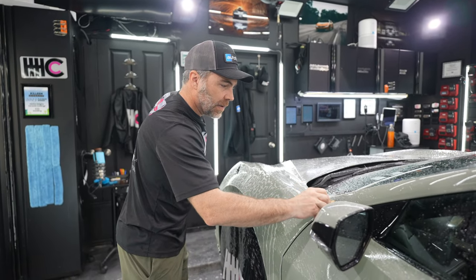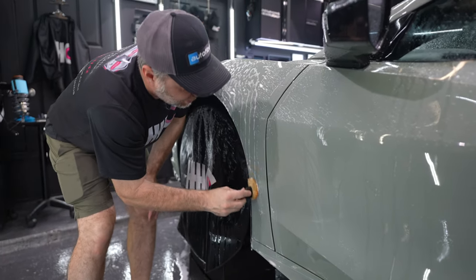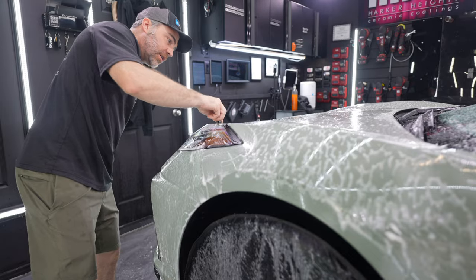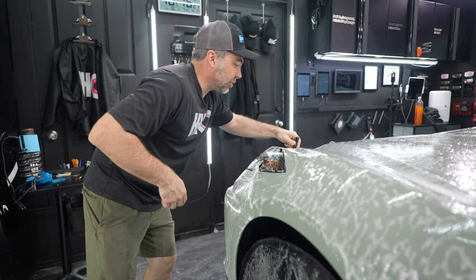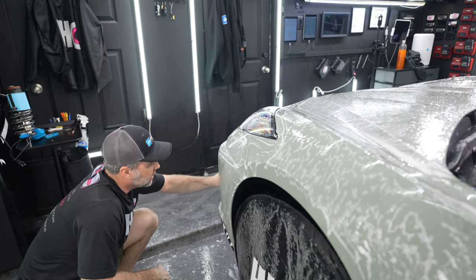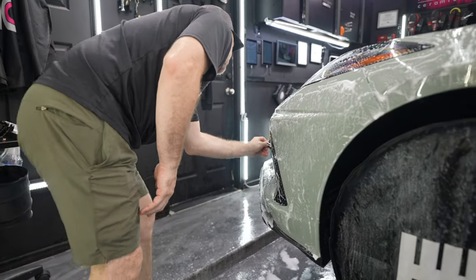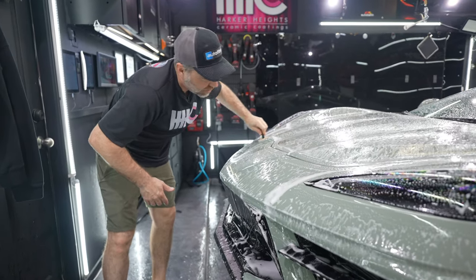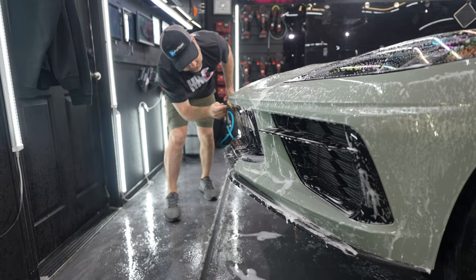The next thing I did was re-spray the front of the car with foam for more cleaning. I'm also going to use a detailing brush to clean in the crevices to minimize any dirt that comes out. You might think a brand new car doesn't have dirt in the crevices, but bring this car off a trailer and it does. Short of completely removing the headlight, which requires the whole bumper to come off, this is the next best thing. Then we'll use that same lubrication to clay bar the front, which removes more contaminants embedded in the paint.